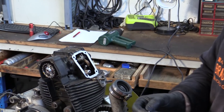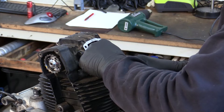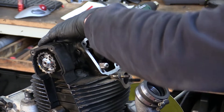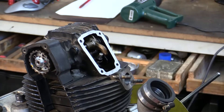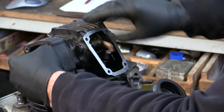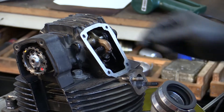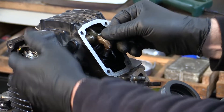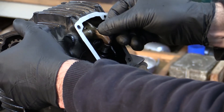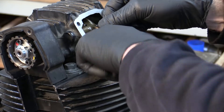I can do 8mm ones with gloves on, but I can't do 7mm ones with gloves on — I tend to start dropping the collets. I'll move the piston down so I can push the valve down again, put the opening shim back on, and slide the rocker across. Now the loaded/unloaded system only works if there is opening clearance. If there's no opening clearance it's not going to work, because you need to measure the difference between that and when you push the closing rocker down.